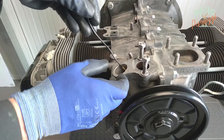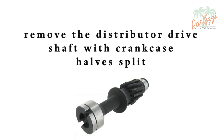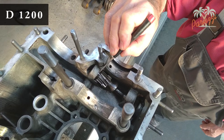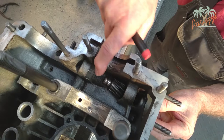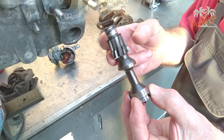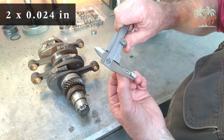We did take the rings out neatly with a magnet to show how it is done. Here we show how to disassemble the drive shaft when the crankcase halves are split and the crankshaft and camshaft are disassembled — you don't need any special tools at this point. This is a D1200 engine; the washers can be removed here along with the drive shaft because the crankshaft is disassembled, which is not the case when the engine is completely assembled. You can see the two washers from our D1200 engine and look at the rings to estimate the wear. These are exactly 0.6mm as it should be for this D1200 engine and they show no signs of wear, so we can just reuse them during assembly.